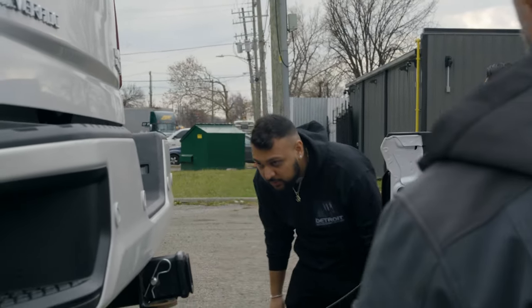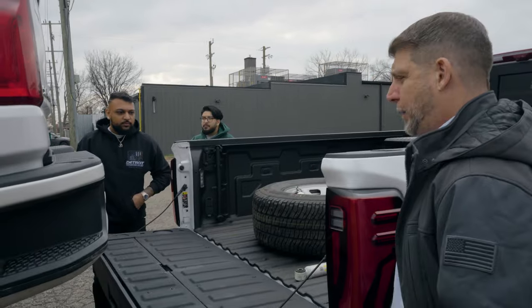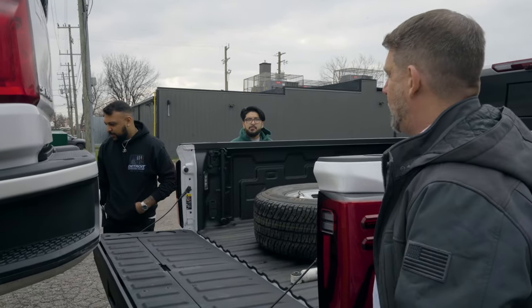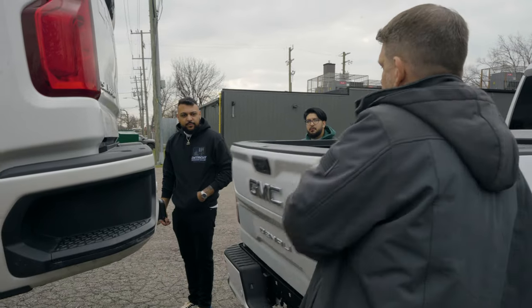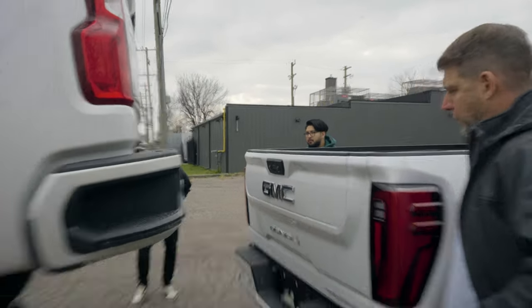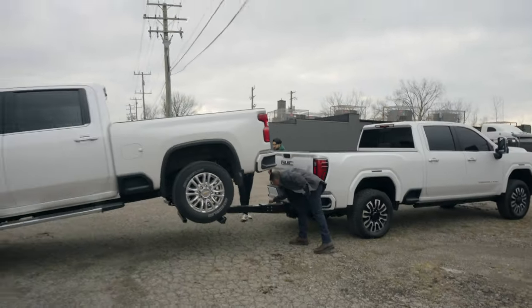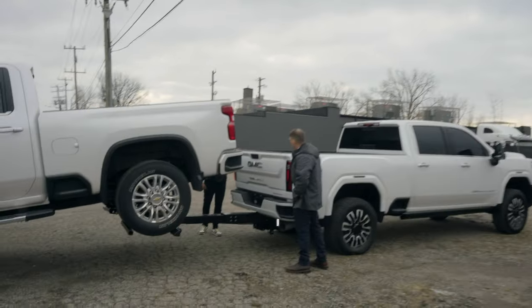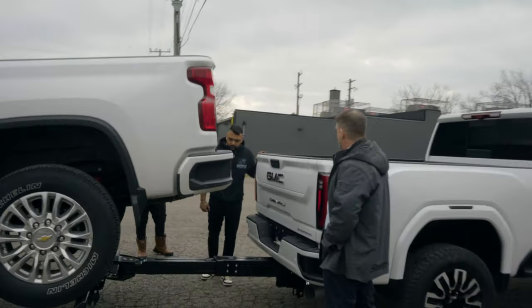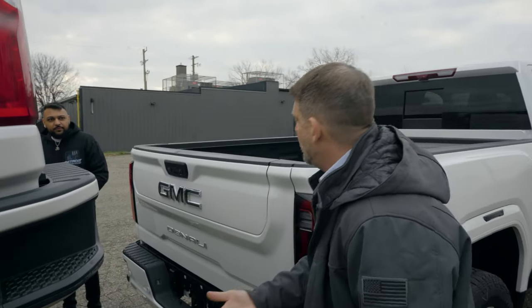And, you know, this is a great rule of thumb another customer showed me that gives you an opportunity to gauge it right away. And I would feel comfortable towing this thing 500 miles just like this. Because it's extended out all the way, doesn't matter. I like these units extended out all the way because now you're on the stops. See these stops? Yeah. So every time you pull up that way, you're pulling on a stop, not on the cylinders, not on the hydraulic. If you were over way more than you were, it still would have towed it.